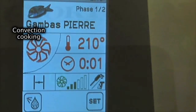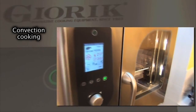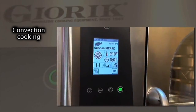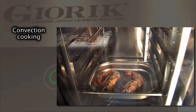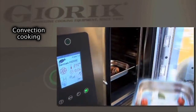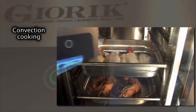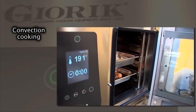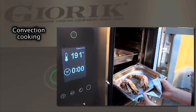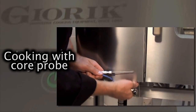In convection mode, Steambox ovens provide six different fan speeds. A special electronic board cuts the fan inversion time to zero, and since the fan never stops, cooking times are more rapid. The software that controls the fan rotation also sets the alternation times on the basis of the cooking cycle set. Specific cooking trials have returned positive results for all types of baking tins, proof that the product has been evenly cooked throughout, including when different foods are being cooked at the same time. During door opening, the turbine is stopped in a very short time to prevent heat dispersion and any residual steam from scalding the user.